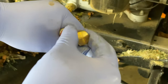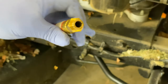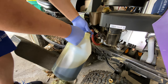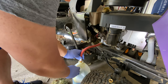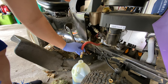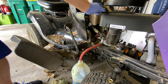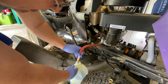I uncap my jug here because the plug right now is above the level of the oil, so I don't have to worry about it draining out. What I might be able to do here is put this right into my container just like that and I'll lower it. Some of that may start flowing out on its own, but it's not really flowing very fast right now — it's just kind of dribbling out. Now that I've done that, I can open up the cap here to the crankcase and let in some air to see if that starts flowing out any quicker.